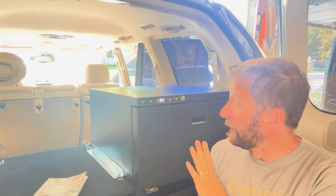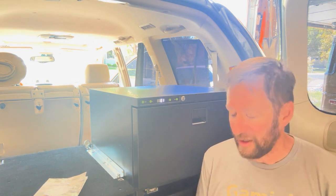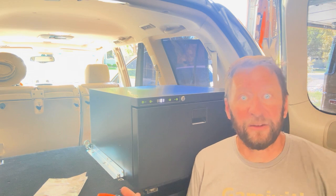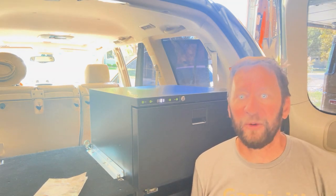So the programming works. You have battery protection that will stop the compressor from running when you hit a specified voltage, but then you still have this parasitic amp draw, which we've measured up to 8 times higher than other fridges. That's gonna continue to deplete that battery, which means, yay, I stopped at 11.6, I could still start the truck now, but not tomorrow. That thing's gonna be down even maybe below 11. Trust me, it's happened to me multiple times.